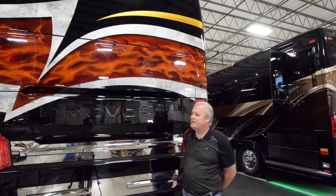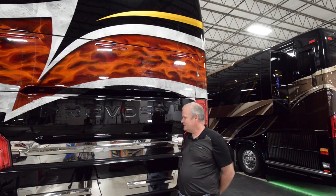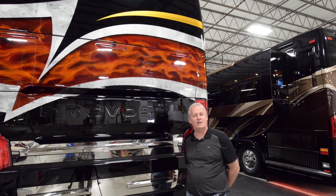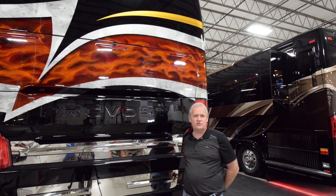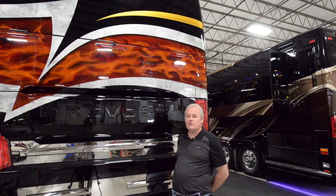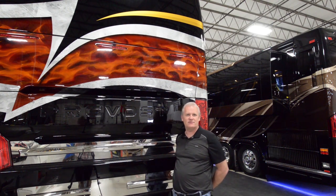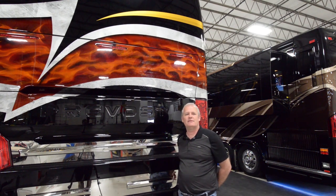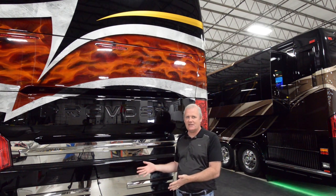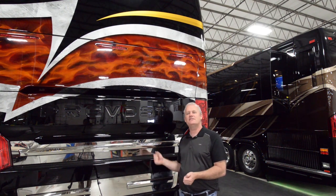What we have here is the finished product for paint. Paint is the first thing we do after the shell has come in, been tested and prepped, but nothing's inside at that point. The reason we do that first is these things get baked at about 130 to 140 degrees, sometimes several times to cure the paint. You don't want to run the inside of the coach with leathers and other adhesives baking. Also, if any paint gets on really expensive leather or expensive fabrics, you'd have to strip it off and replace it. This way you run the risk of having to touch up some damage at the end, but the other way — painting it last — there's much more risk. There's no perfect time, but this ends up being the best for us.